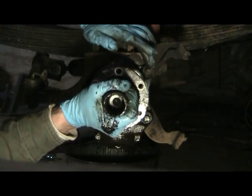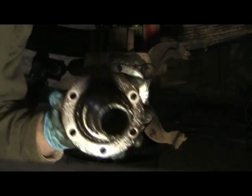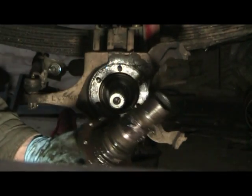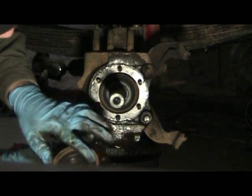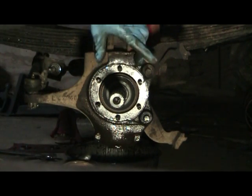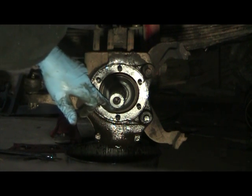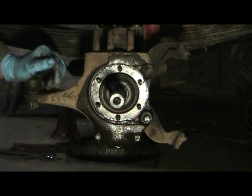And that's that. It took long enough, but that's your actual spindle — you can't really see it but that's what slid on there. It's got both of your raised seats for your bearings, and it also mates up with the seal for the hub. I'm going to need to replace that — there's cracking and fluting on this seal, and when I push it in you can see the inside has separated away.